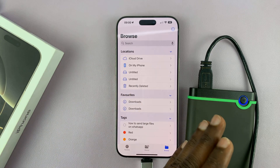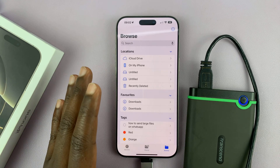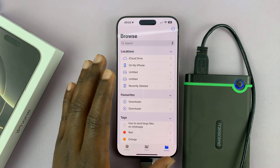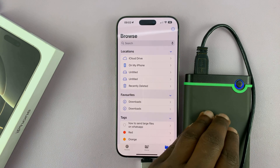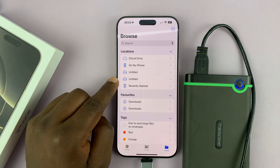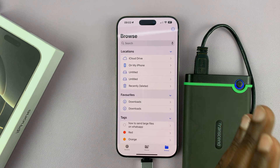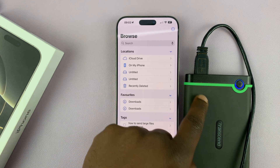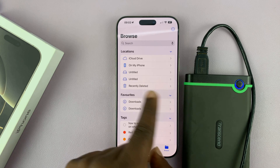You can also transfer files and folders to and from. Keep in mind that you can copy files and folders from an NTFS hard drive onto the iPhone, but you'll not be able to copy from the iPhone to the NTFS hard drive. For the FAT32 partition, you can actually copy files and folders — even photos — to and from, meaning from the iPhone to the hard drive and from the hard drive to the iPhone.